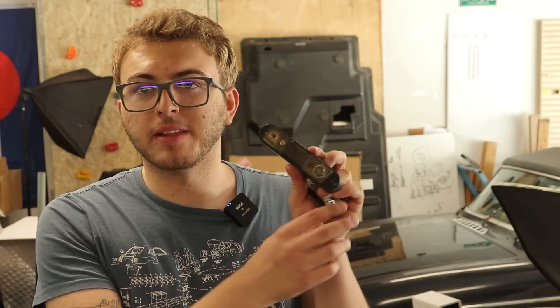Now it's time to wire up the shunt. This is the shunt that came with my display, advertised as a 1000-amp shunt. What confuses me is the factory Electrex shunt is rated at 200 amps but is physically bigger — I feel like the 1000 should be bigger than the 200. Regardless, I'm using the 200-amp factory shunt because it works with the factory Electrex display and will keep the factory gauges working as they did from the factory.